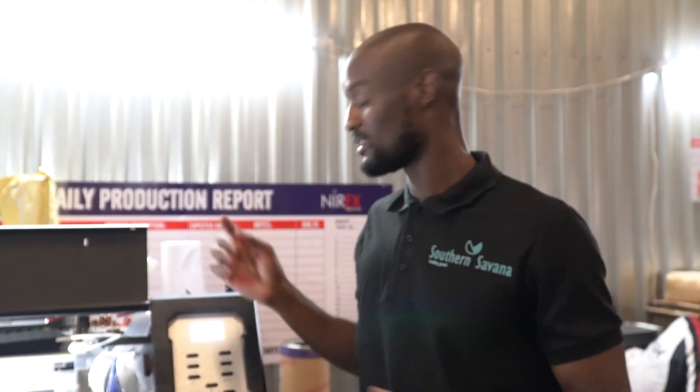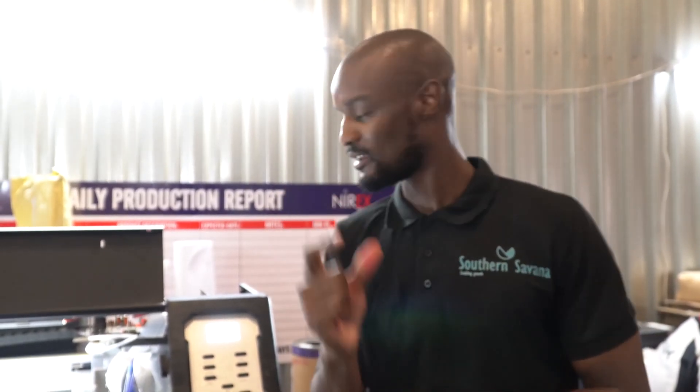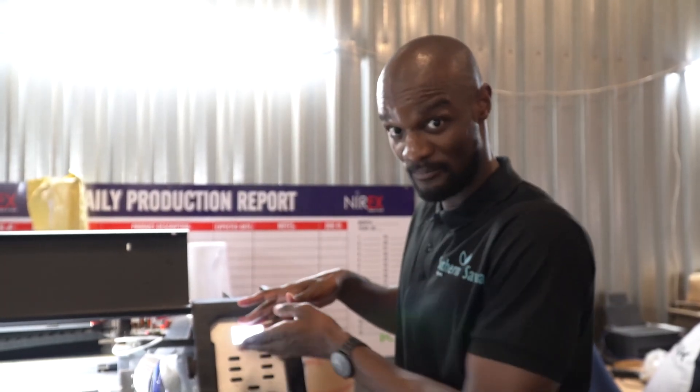So I've spoken about the process of diagnosing error 16. The first thing was we separate the board to see if the board is the problem — and we've seen that the board was fine. Next, we check if the connections are fine between the head cables and the chip. If error 16 still comes after checking connections, try replacing that chip — the V3 or V4 head chip. If the error still keeps coming after that, we do have heads in stock and that's the next thing to change. Please take note of these three to four steps before concluding that the head is the problem — there could be so many other things. Thank you so much from here at Southern Savannah. Catch you next video. Cheers!